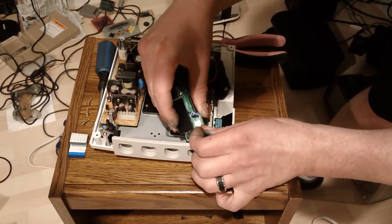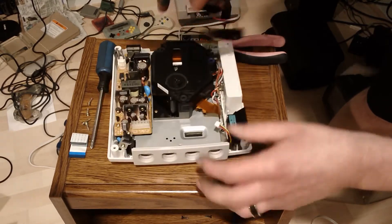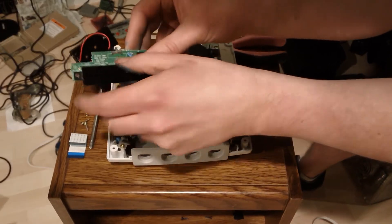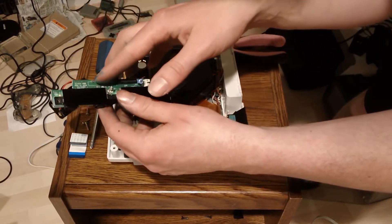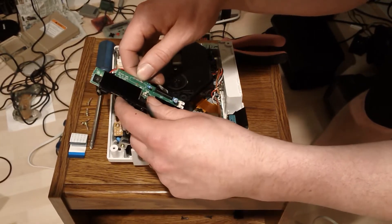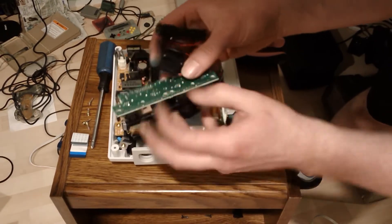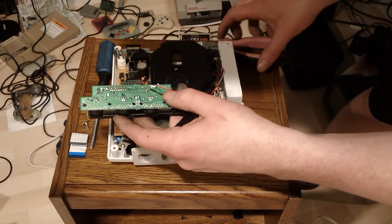Always pull from the connector. You don't want to ever separate that because good luck finding one of those connectors these days. So you've got the Dreamcast controller port with the battery port right here. It was actually soldered on here, which is great because it won't fall out. But over the years, when something soldered like that goes bad, you either have to desolder it or just break it off and try to re-solder some new points. The positive is this point here and the negative return is right there.